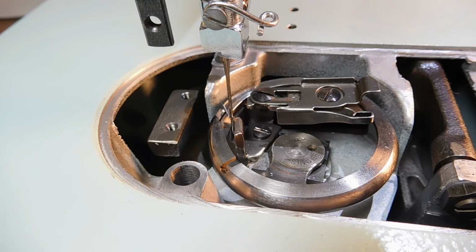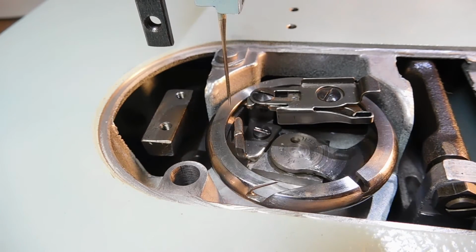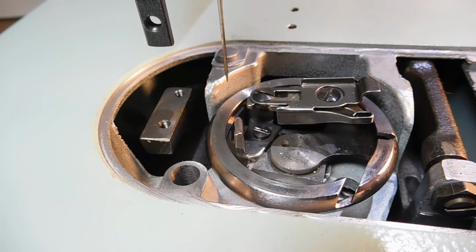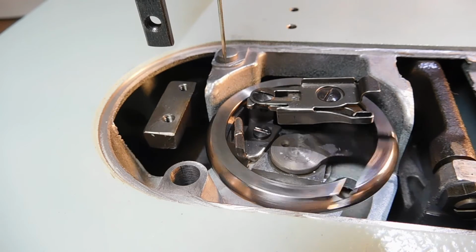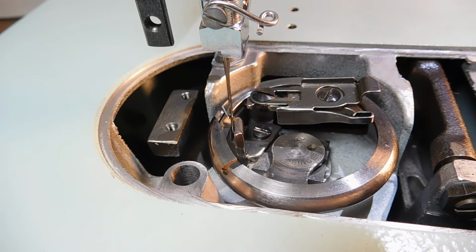Maybe now I've kind of got this area covered with how that oscillating horizontal hook works. It's too cool. And I checked for burrs. The hook is clean, and I checked my timing on the upstroke. Go all the way down and come up to the timing mark, and man, that needle is right there. Just too good.